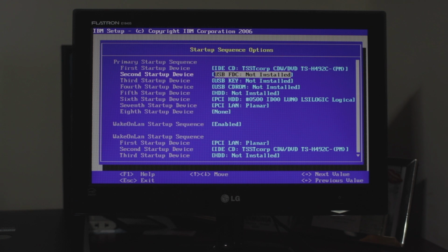So here I need to actually burn a CD or find a floppy disk drive to just be able to update the BIOS to the latest revision, and that should support USB sticks. I cannot find a USB stick that small these days. I have a 32 gigs one, but where most see a problem, I see an opportunity. I'm learning in the meantime to set up a PXE server, and I'm gonna try to install Linux this way.